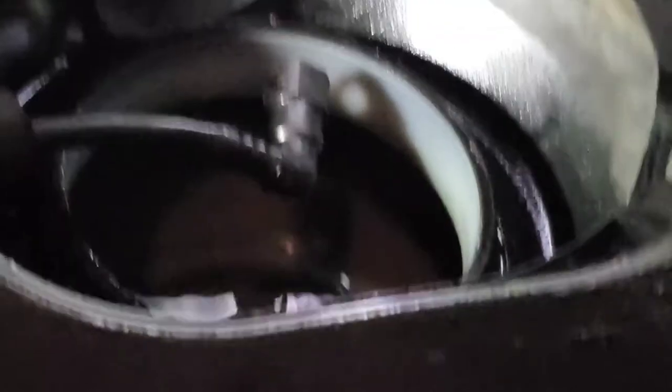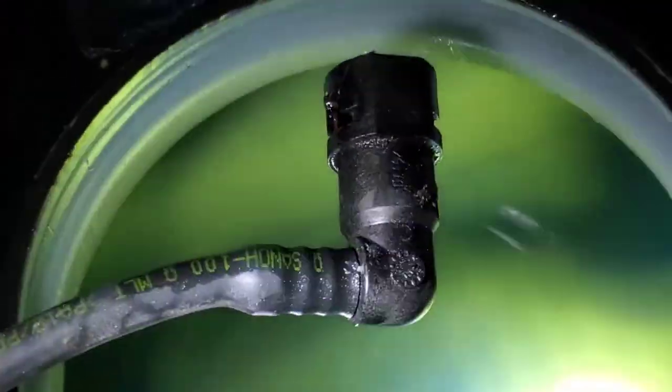I've lost it — the tank is full. The fuel level is right up to the lip; you can see it at my finger touching the fuel surface. Looking inside, the problem I think I have is that whoever kept pulling this thing in and out did not know about the float. There's no float on this assembly — do you see one? There's no float in here.